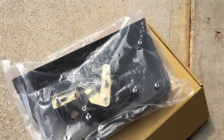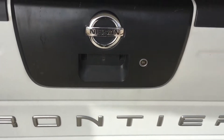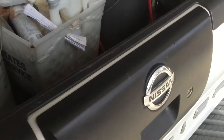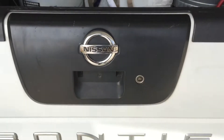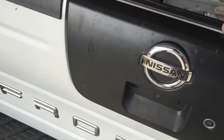I'm going to attempt to open this so I can get the part back on. The videos I've seen online show a small problem: when the door is shut you can't get to the two places in here where this black tailgate cover is attached. That means it's difficult to get to the area where these screws are. Right behind these screws there's a panel that falls off, and once that panel falls off there are two rods — one goes this way and one goes that way. When those rods are pulled it will allow the tailgate to fall.